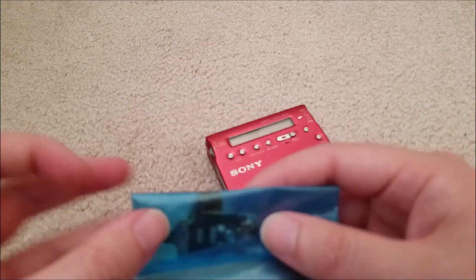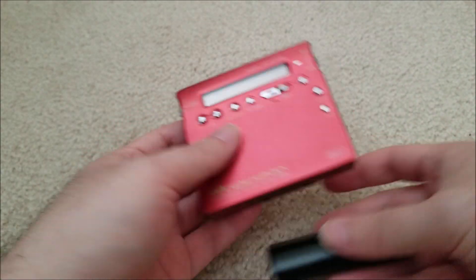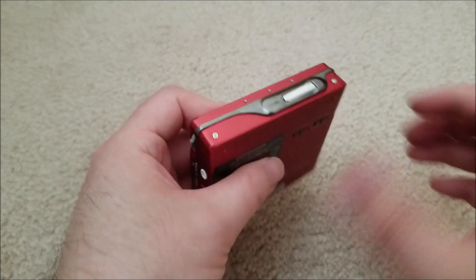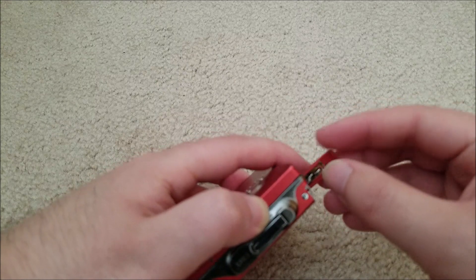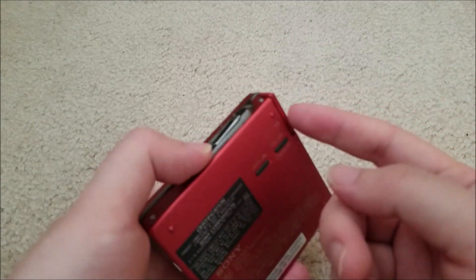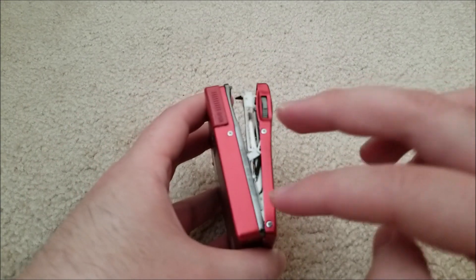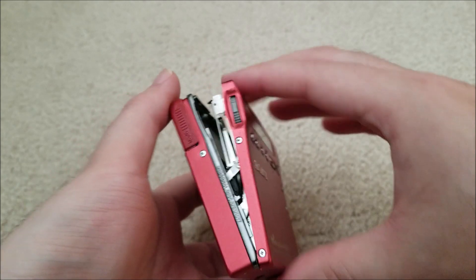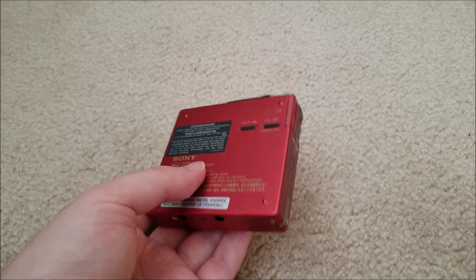It comes with just a laser sled and ribbon, and we'll have to take the overwrite head off the old laser and transfer it. Let's get into this. It's going to be fairly simple to take apart: two screws on the top, two screws on the bottom, the back part will swing out, and we'll need to lift one of the little metal parts latching the door, remove that, push the door inward, then take off two screws on the front and two screws on the other side of the front, undo the ribbon latch for the front PCB with the screen. I'm going to speed through this since it's pretty easy.